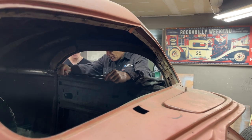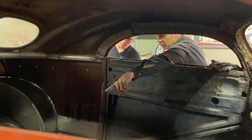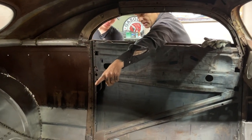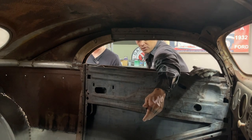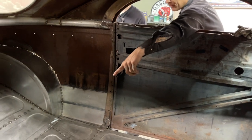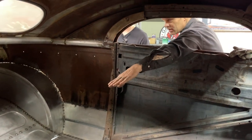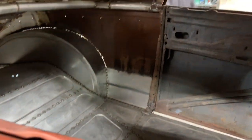There's a half-inch lip bent on the top. When I made the pattern for the wheel well in the back, I just made the pattern going straight from the post to the wheel well — that's all I've got. I want a half-inch bent over for strength, and we're going to bend that going towards the quarter panel. On the bottom, going from the post to the wheel well, I'll have a hole there, so I'm going to make it bigger — adding four inches on the bottom.